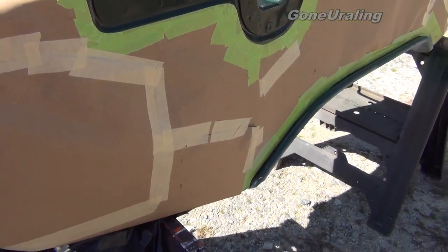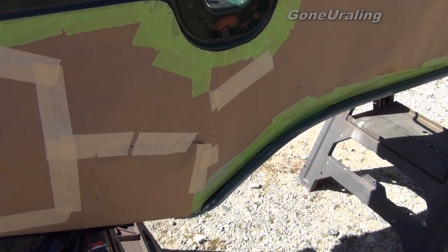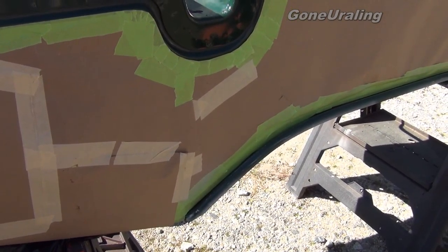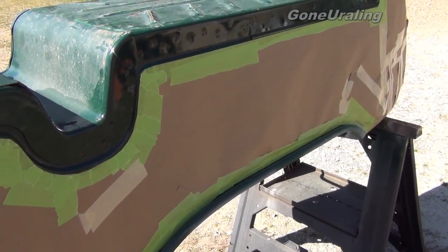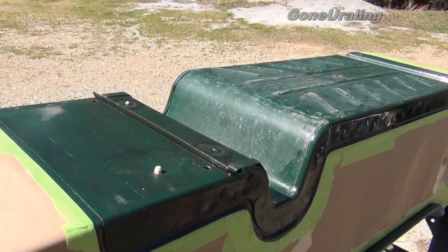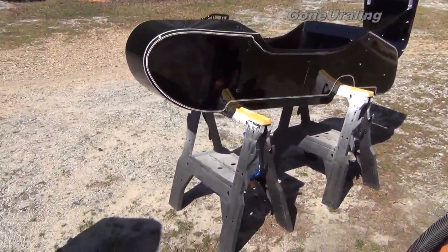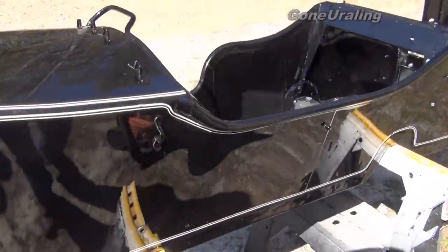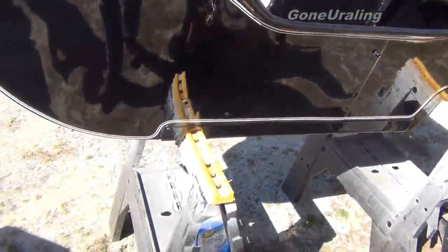We're making progress. We got it all taped up, got the inside all sanded. I used primer on bare metal as they recommend, and I also used the adhesion promoter pretty much in all the high-traffic areas — the bottom and the handrails. We're doing the bottom now, gonna get it prepped and then get that tub done. We got it sanded but we've still got all the tape to do and then we've got to do the bottom of it too. A little bit at a time.